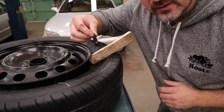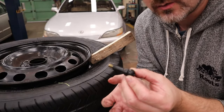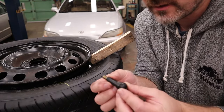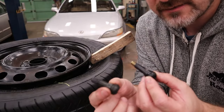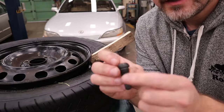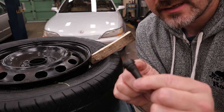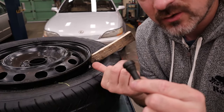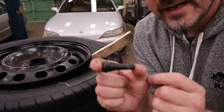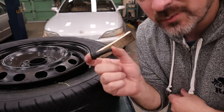At this point the stem should basically just pull out — and there's your broken stem. Take this to your local parts store to get an appropriately sized valve stem. What's really important is the diameter right next to the top round cap — that diameter has to match so it plugs the hole and doesn't leak. You also want about the same length; you don't want something way too short or way too long going in to replace it.